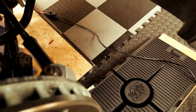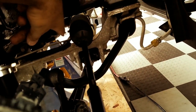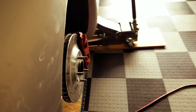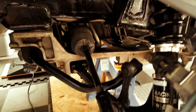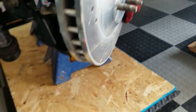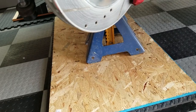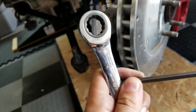Now I need to remove that — there are a couple of bolts over there and some power steering lines that I have to remove. I'm going to try to yank this thing out through the driver's side wheel well. The driver's side tie rod is already out. I'll show how to do the passenger side — you need a size 6 hex and a size 18 wrench.